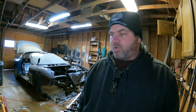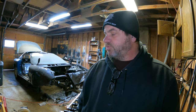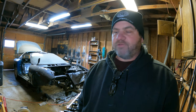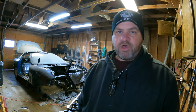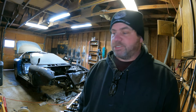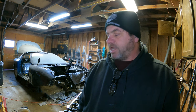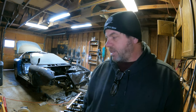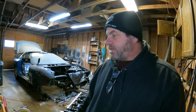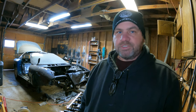So I ordered another torque wrench off Amazon that had super good reviews, like 12,000 reviews, and it was 4.5 stars. It's the Lexivon. I've watched a bunch of YouTube videos on it, and everybody said that they've had super good luck with it. So I've picked up that torque wrench. I had to wait for it to get here, obviously, and I've torqued the inside main cap bolts down on their first pass to the 15 foot-pounds.